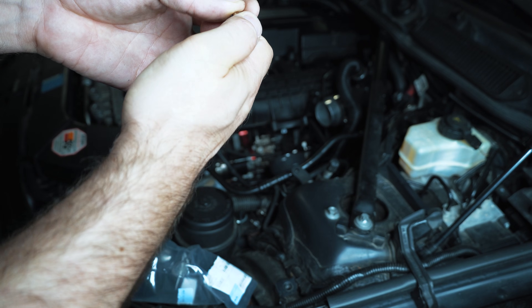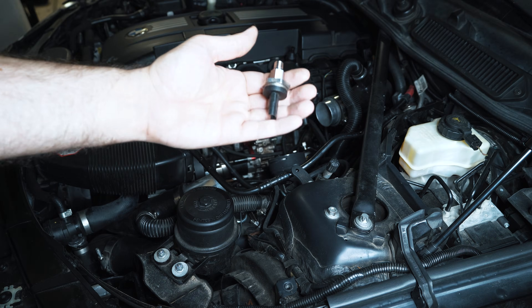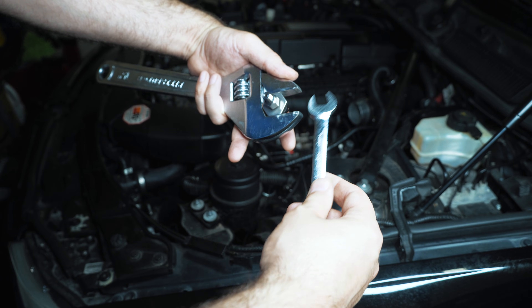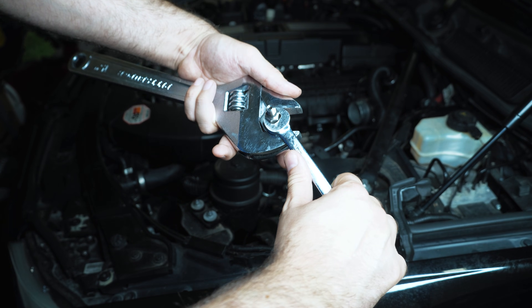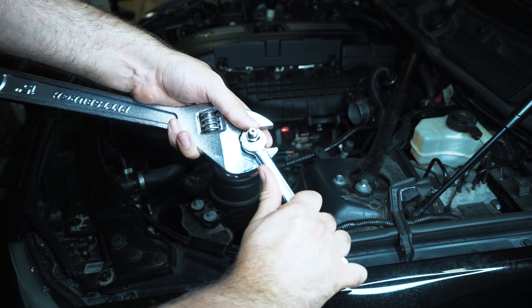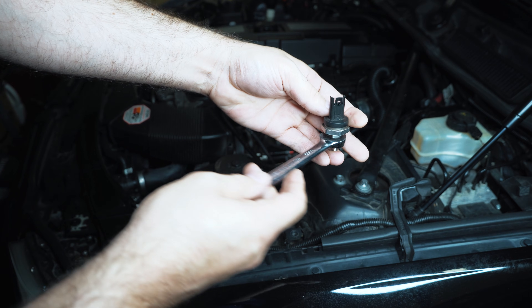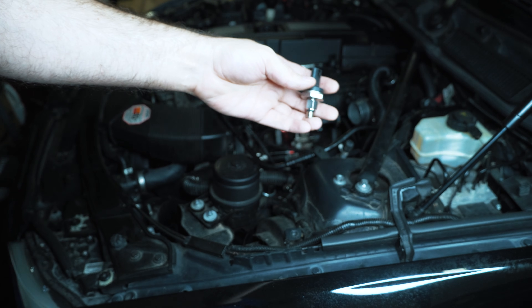The brand new O-ring will just slide over — we're in good shape. I'm going to screw these together now. The second gen Bosch sensor takes a 27mm and I'm using a 14mm to tighten them to each other. There's a nice solid connection there. Now this will be easy to screw back on the car and just use a regular wrench.